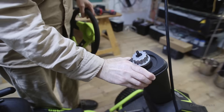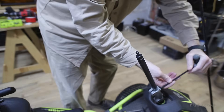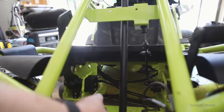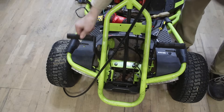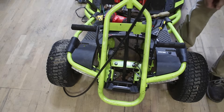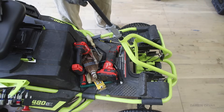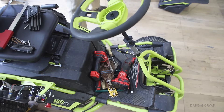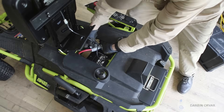When we were having the first problems — the hesitation in the motor, or it wasn't working at all — the first thing I did was check near the pedal. That part is basically a potentiometer that tells the motor controller how much you want to accelerate when you move the accelerator. I took it off, tested it, and everything seemed okay — I was getting basically zero to four or five volts, within the normal range. So it wasn't that.